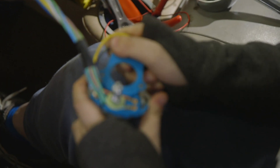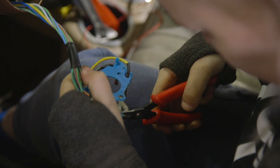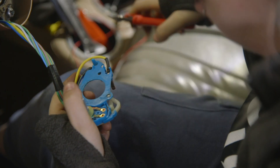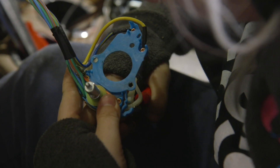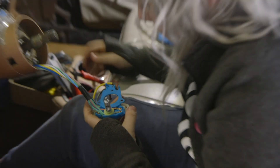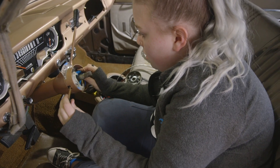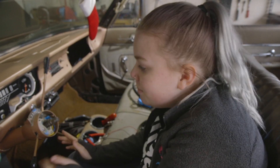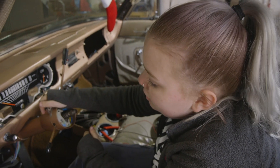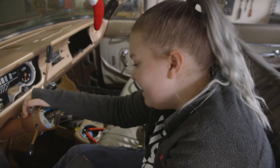Testing the turn signal action - that's right, that's left. I'm not trying to cut any more off. Those are a lot easier now. So next, we know that the column is not making good contact with the steering wheel, which is why many of these problems could be happening. We are going to scoot the column up a quarter inch to a half inch.